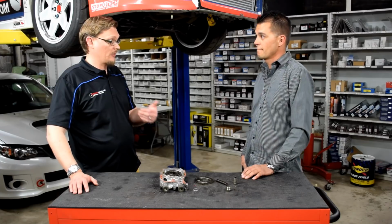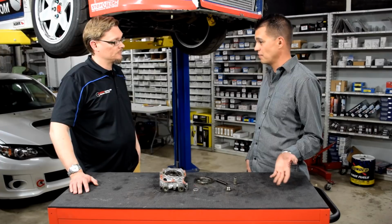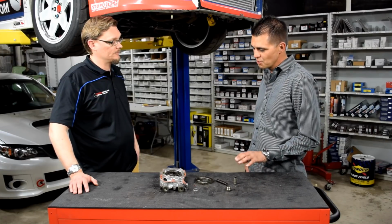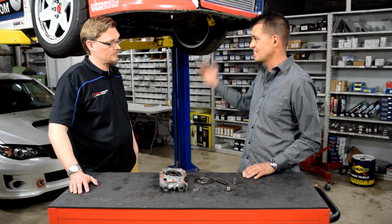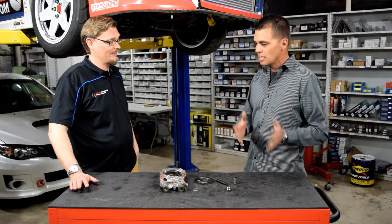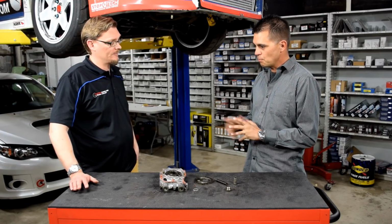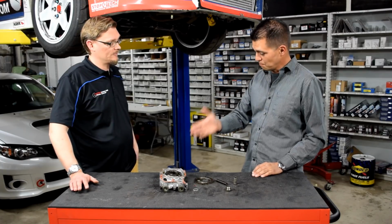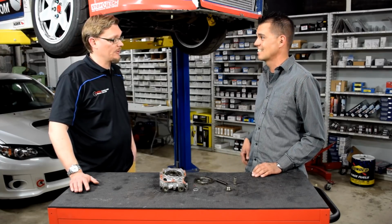Even at our high RPM with the larger pump. Yes, and in my case, I'm revving up through 8,000, 8,500 RPM. There's a lot going on, and of course, for those watching, we can get really heavy duty into the details of the intricacies of the block and the oil galleys and flow and the bearings. But in my case, from what I've seen from my pressure changes, I know that given my setup, I'm going to leave the 12 millimeter pump on there versus the 10 millimeter pump.